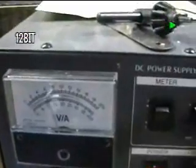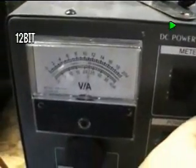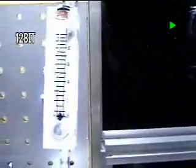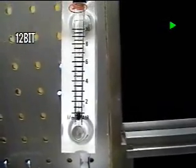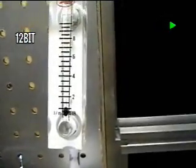Now what we'll do is back it down a little bit again — we'll reduce the amperage and voltage. We'll take that back down to 6 volts, and we're back again to about 4 amps. As you can see, it's directly proportional — you can see the gas output slows down. Still going from 0 to 2 liters a minute, but it's pulsing. So that gives you some idea of what this tiny HHO generator can do. It's used on a 1.2 liter to about a 3.0 liter engine.